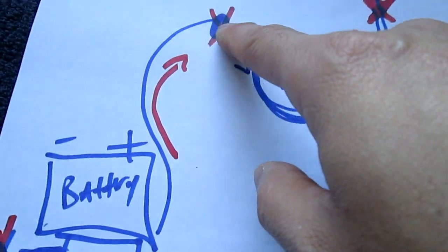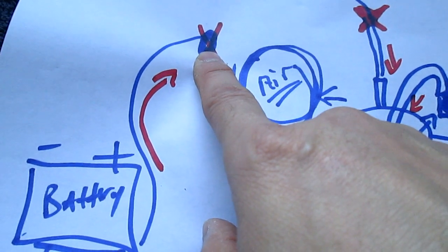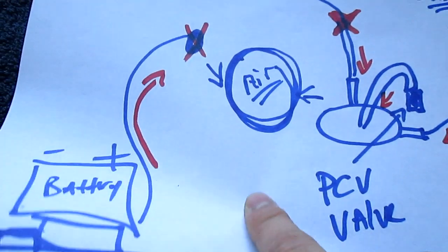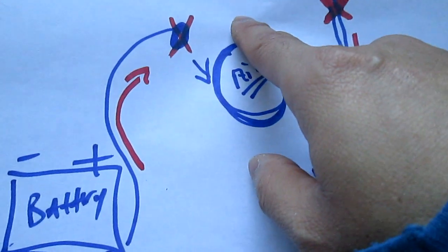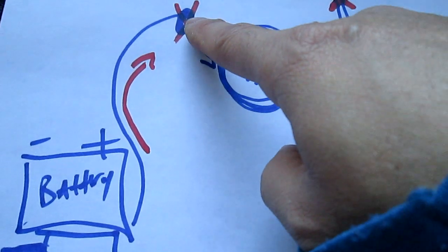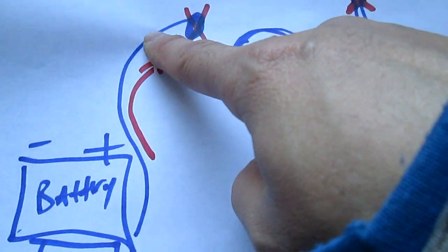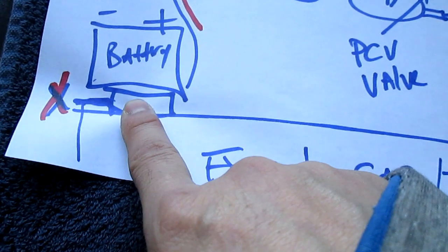Let's get back to the 4x4. If you energize the 4x4 for four-wheel drive — remember, these things are rear-wheel drive. When you energize the four-wheel drive, it actually actuates the front wheel drive. So when that happens, it comes to here and then it actuates an actuator. Now for the S10, there's another tube that breaks off from here and it goes into an evaporative system.